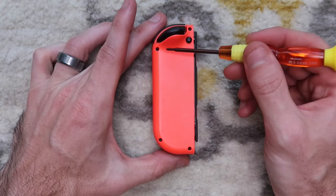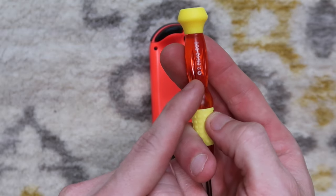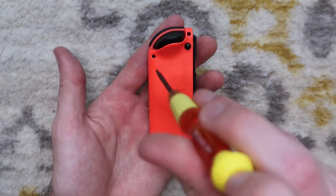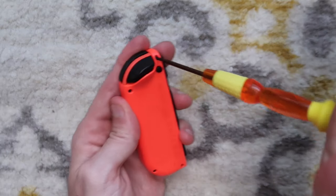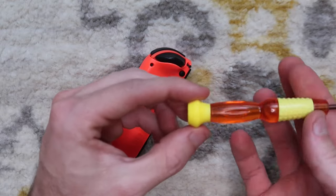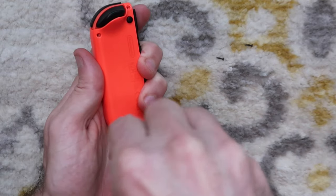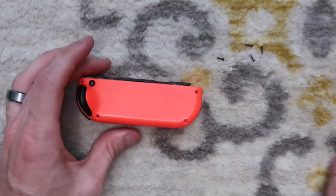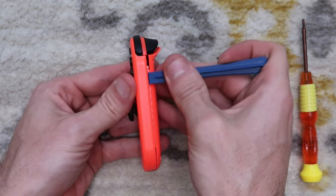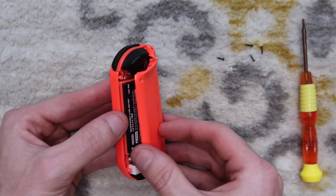The first thing we have to do is take off the four outer screws using the tri-wing screwdriver. You can tell it's the tri-wing by looking at the bit or the sign on the screwdriver. Apply pressure with the palm of your hand while you twist — that's why they have a swivel on the screwdriver. All four screws are the same size so you don't have to worry about mixing them up. Now that those are out, take the plastic spudger, work it between the Joy-Con, and separate it to pop the bottom off.